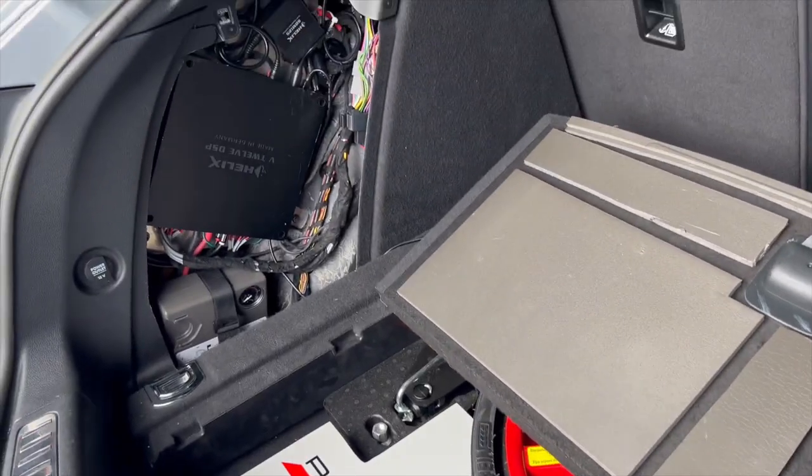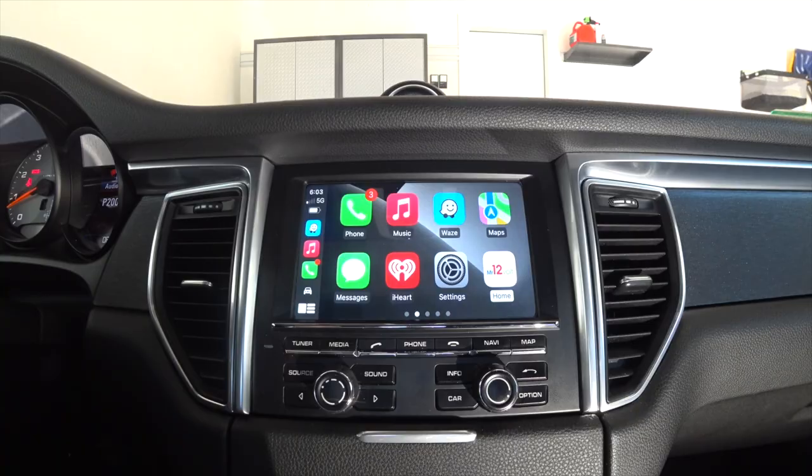I connected the audio directly to PCM, bypassing the Isudar and Joye modules, and I used wireless CarPlay to send video signal to the PCM. That way I could still see CarPlay on my screen while enjoying high quality output directly from my PCM. The drawback was that apps that use CarPlay to route audio would not work.